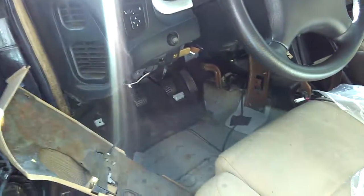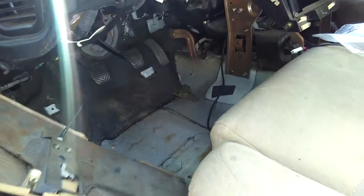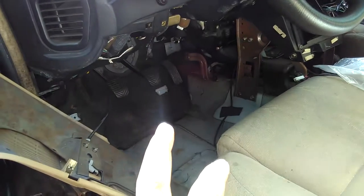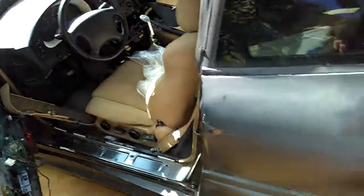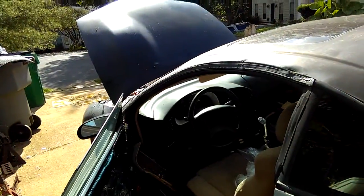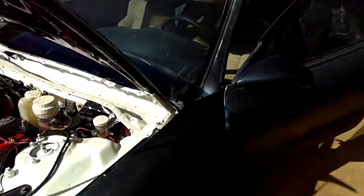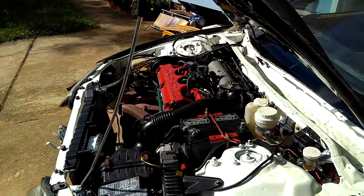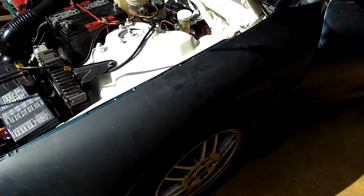And if your brake is bad, when you pump the brake pedal, the first pump, you will see it's not hard. It's going to be soft, and it might be squishing down, for the first pump or so. The reason is I forgot to do the bleeding process here at the tire before I drove it. So I installed my master brake cylinder on, and I didn't do the tire bleeding process, and I cranked it up. As you can see in my other video, I cranked my engine up and I got excited, and so I drove it without bleeding my brake lines and all that.